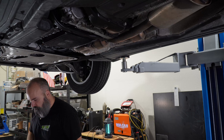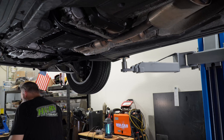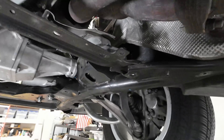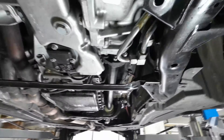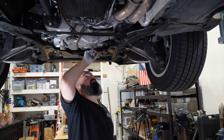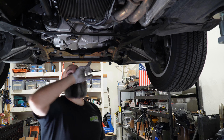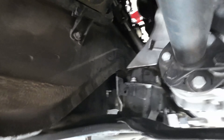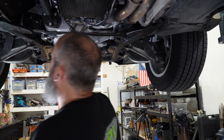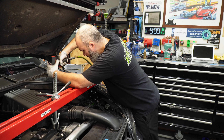Now that we know where we're chasing, we need to go ahead and get all of these splash panels off — the rear tranny cover, the front panel, and our center support section. With all the panels off underneath, you can see we have pretty awesome access to the passenger motor mount. The driver side though, I definitely see where you'd have to pull the intake manifold to get that upper bracket because you have very limited access down underneath. I'm going to have to lower the car, pull the steering shaft, and get to the front bolt on this driver's side motor mount.